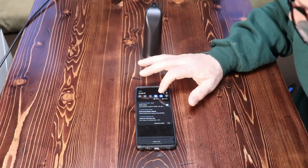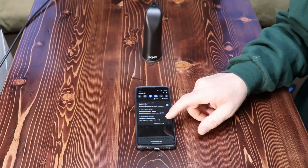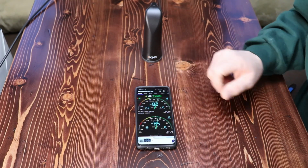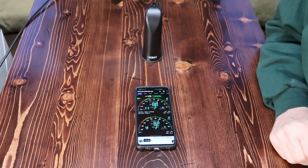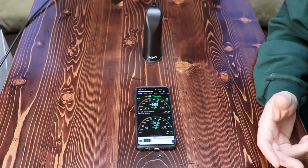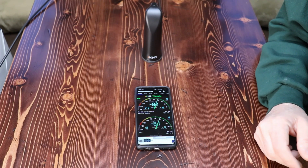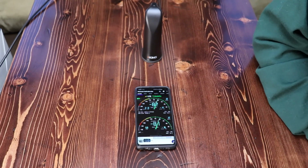So the booster's on now. I'll take it off airplane mode. It'll let it connect to the booster. Sometimes you need to reset your phones to do that. And I'm looking at negative 80 dB, so a definite gain of 22, 23 at least. So we know everything works and we're getting great boost. As you can see, pretty easy install. I didn't even cut myself.